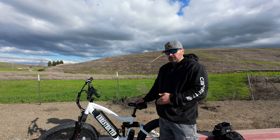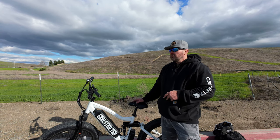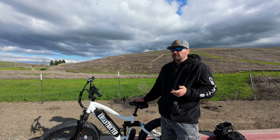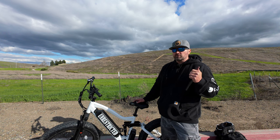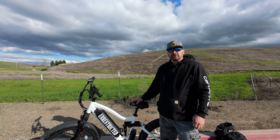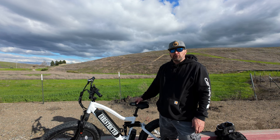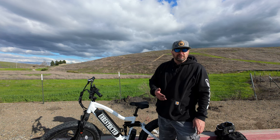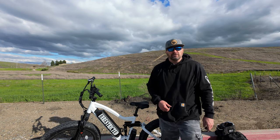Alright guys, in conclusion — what did we learn today? The 46-tooth chainring in combination with the 11x34 freewheel, in my opinion, makes this bike into a very capable climbing machine. I absolutely would not have done that trail with the stock configuration. My Strava crashed so I can't tell you the exact elevation, but man that was quite a bit of climbing. I would absolutely recommend the 46-tooth front chainring if you live in hilly terrain, but if you live in flat terrain the 56-tooth is fine. Either way, getting that 11x34 freewheel is an absolute must — no downside to it. You get the same top end but 18% lower bottom end. Thanks for watching — stay unrestricted and I'll catch you in the next video.